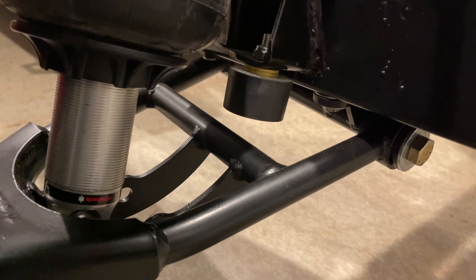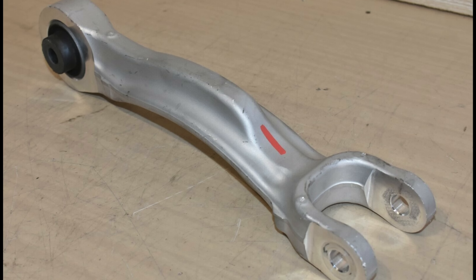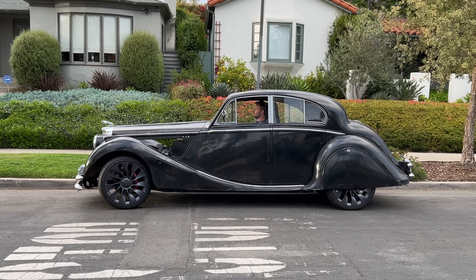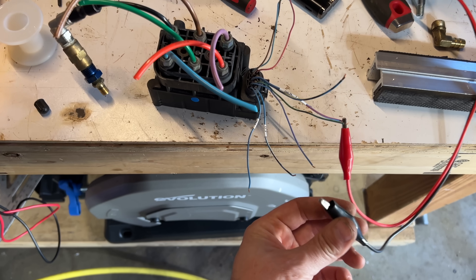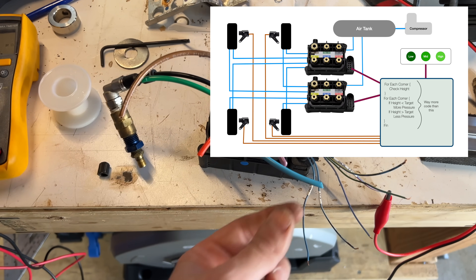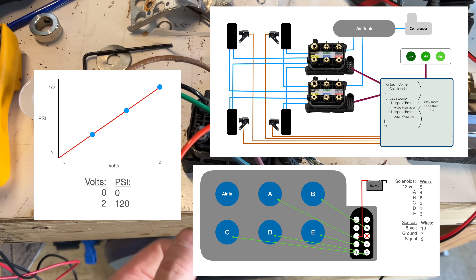I am currently limited on my lowering. I have bump stops in the front, but I can move those up and get another inch or so up there. In the rear, I'm contacting the frame with the front upper link, which is not good, but Tesla uses a different link on the Model Y which I should be able to swap in and get another inch or two out of the rear. And then I can be that guy high-centering my car on a speed bump. Saved myself a lot of time, which is good because I have way too many projects going on right now. But now you know there's an easy way and a cheap way. If you want a simple system with switches, you can do it pretty inexpensively. And if you want the junkyard system, you can do that too — I did most of the work, all you have to do is write the code, install it, make a video, and take all the credit.